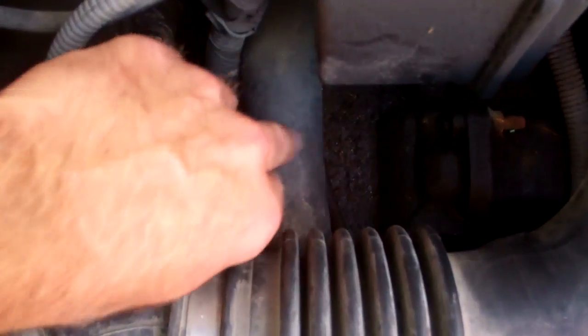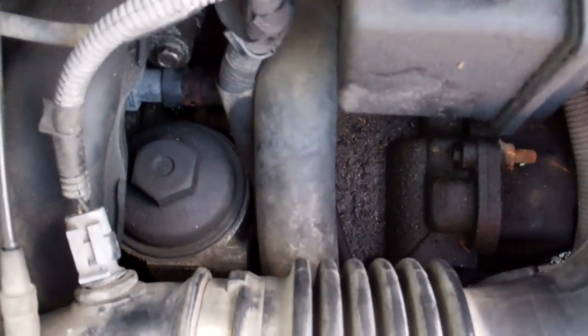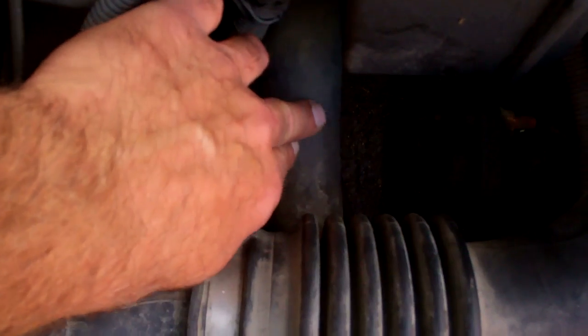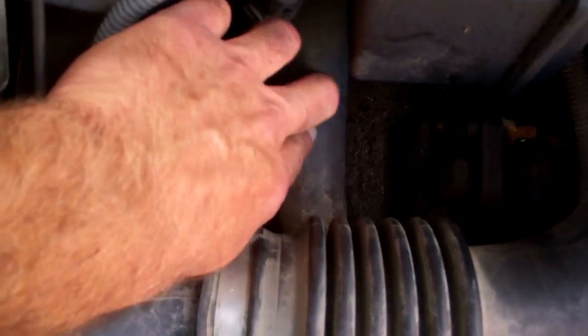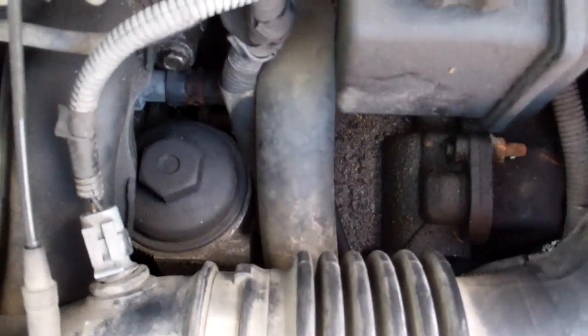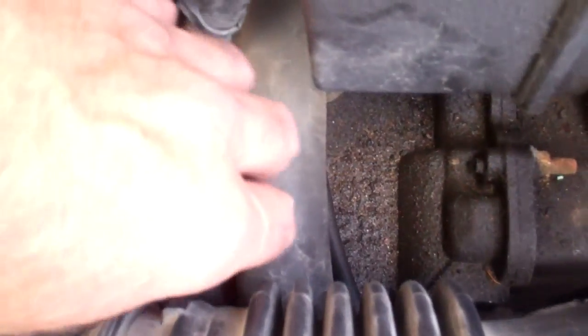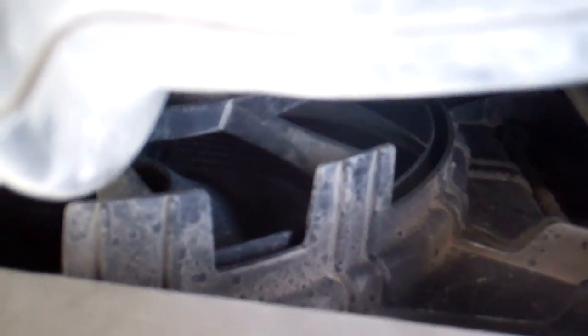The hose to the upper part of the radiator is now so hot that I can't lay my hand on it for any length of time. Not eliminating anything yet — thermostats can be intermittently working — but at the moment, because that hose is hot, that generally indicates the thermostat is open and is letting the coolant flow through. But I am wondering about that fan and the control circuit for the fan. We're well above half on our temperature gauge now. Something should have kicked in to start cooling this engine back. Our fan has not operated, so it looks like this is going to turn into a video about troubleshooting a fan and its control circuit.